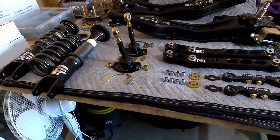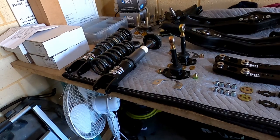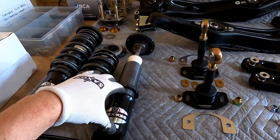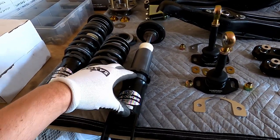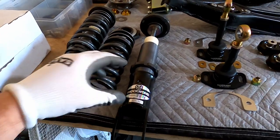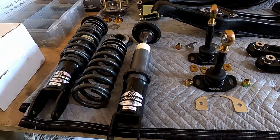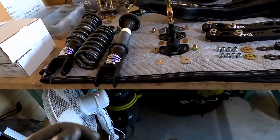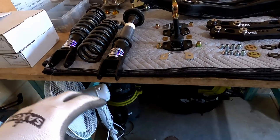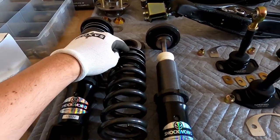The other thing I want to do with this video is illustrate the proper way to set up coilovers. There's a lot of misinformation on the internet, some of which actually comes from the companies themselves, which is pretty disappointing. It's all about how you adjust ride height versus setting the overall travel. Companies like BC will tell you to only adjust the lower mount to adjust ride height - that's completely wrong. The lower mount sets the travel of the suspension - the upper and lower limits of the wheel's travel. Once you've set the droop and compression you want, and confirmed it's not hitting the body, that stays locked. Then you adjust ride height using the spring perches and spring length to keep the spring captive, or use helper springs.